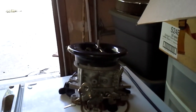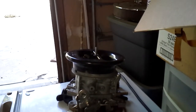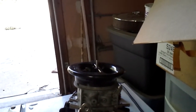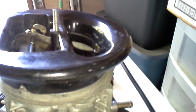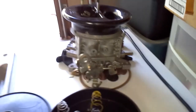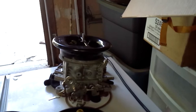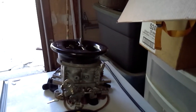I don't know how it's disturbing or interrupting the airflow into the carburetor, but I've heard you have to have a certain amount of distance between the top of that stub stack and the top of your air cleaner for the air to be able to turn properly. When you have too short of an air cleaner, your vent tube is obscured — it literally opens into the radius on the back of the stub stack and dumps straight down into your vent tube. That was another concern people brought up: if you don't have the extended vent tubes on your main body, the stub stack will actually interfere with the venting of your fuel bowls and can cause problems in that area too.